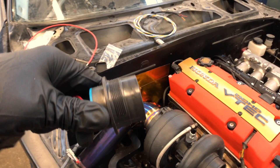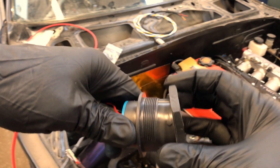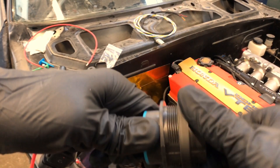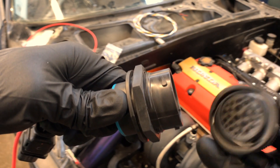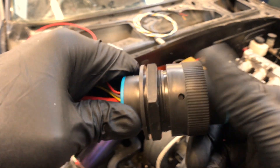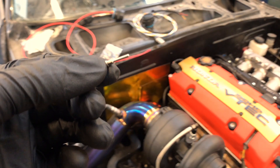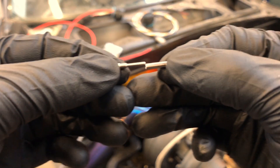Let's explain the bulkhead connector itself. You slide it through the firewall and this nut tightens it down so it locks in place — there's a flat spot on it to keep it from spinning. This is the plug end; it only slides in one way, and then you spin the collar. There's a little click at the end — that's how you know it's fully connected. Same thing to pull it off. This shows you the types of pins that sit in each one; the pin actually slides inside the receptacle.